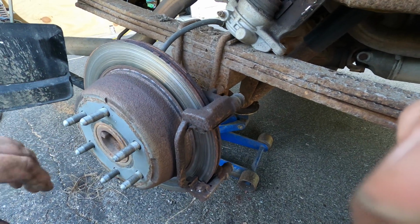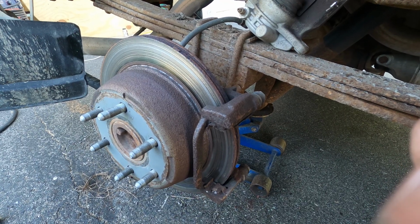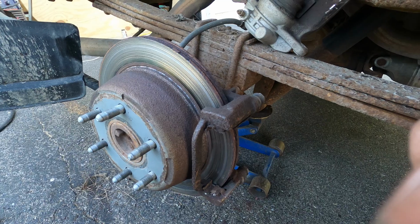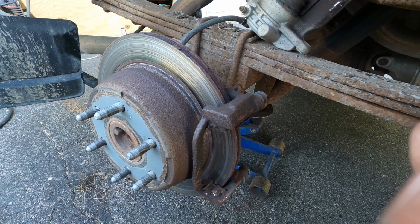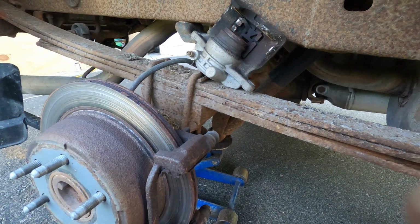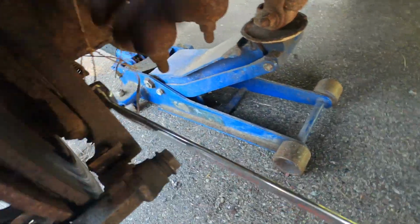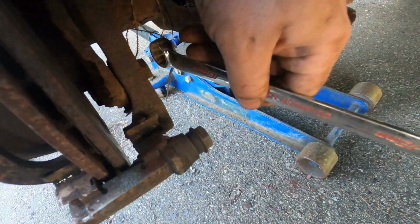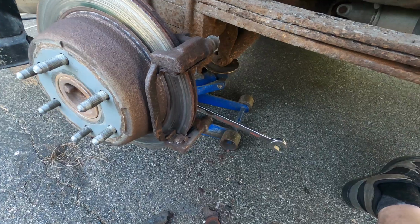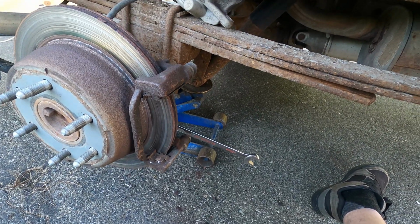But it hasn't been 10,000 miles. I take that back, it probably has. It hasn't been 20,000, I know that. So I hope there's something wrong with the hard lines somewhere. But okay, and then the rear bolts are 18 millimeter to take the carrier off. And these I end up having to bang on with the hammer just because they have a pretty high torque value when you put them together.